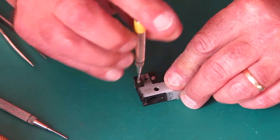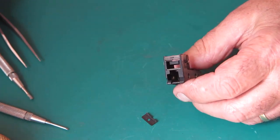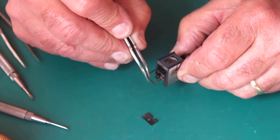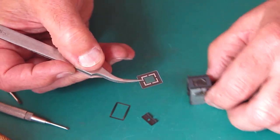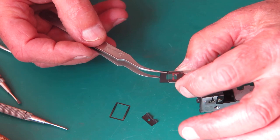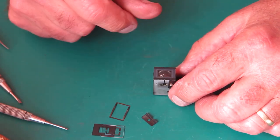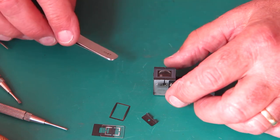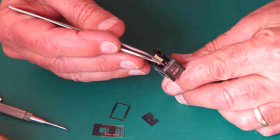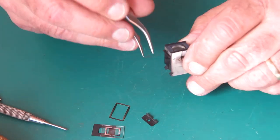To remove and clean the rest of it, I remove this screw and that bracket from the side. This is quite complex in here — there's a spring tab here. Sliding that out, I've got a glass with mirrored frame lines on it and a black mask. That comes out of that central slot. The mirrored frame lines face to the front of the rangefinder — they're on one surface of the glass only, and it needs to face to the front.